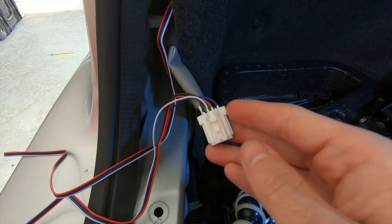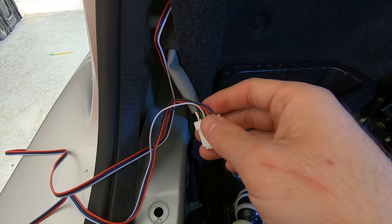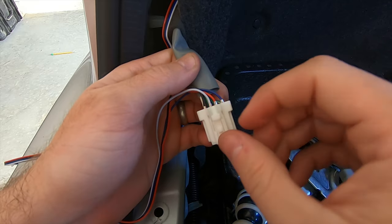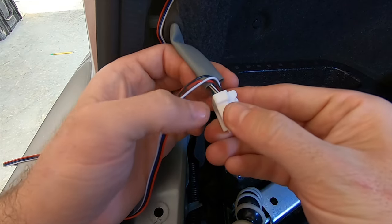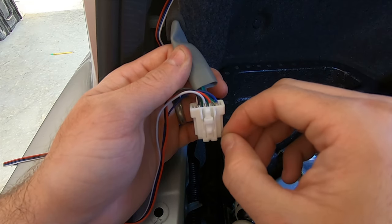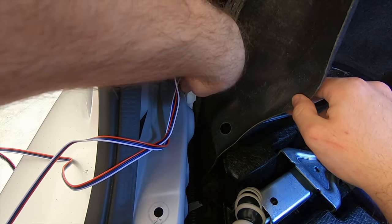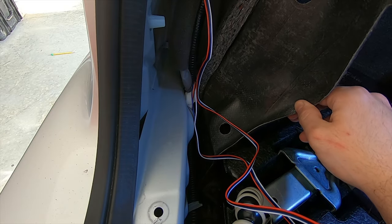The seller has a picture uploaded in the listing images showing the wire assignments: black wire is negative, white is the signal light, blue is the brake light, and red is the DRL. Looking at both plugs, they're wired in the same exact orientation — from left to right: black, white, red, blue. The black wire goes into the black and white striped wire as the ground, and so on. These clips essentially just push into the top, and using needle nose pliers you push them down until you hear a click — that's the clasp locking in place on the original connector. With that I'll plug them back in, zip tie the excess wire to the foam wire, and close it up.